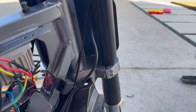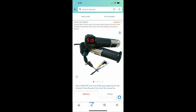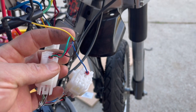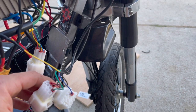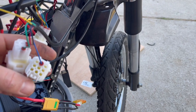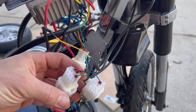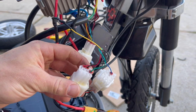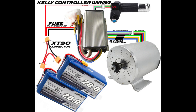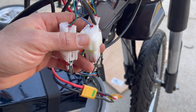From the throttle — this Amazon throttle with voltmeter — yellow is gonna go to power, whatever positive you've got. Green from the throttle goes to green 3 on the Kelly. Blue from the throttle goes to pink number 7 on the Kelly. Red from the throttle goes to lavender number 4, and black goes to black number 20. Note that the blue will have its own separate connection from the green, black, and red.